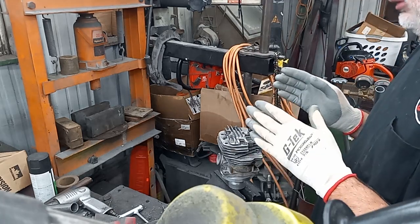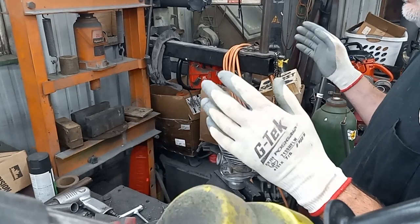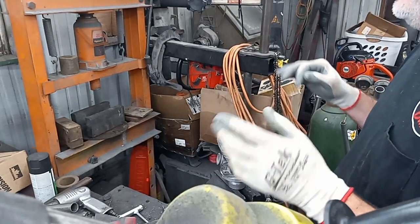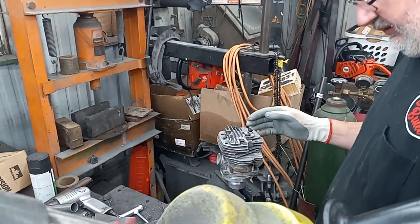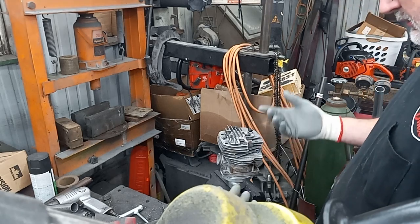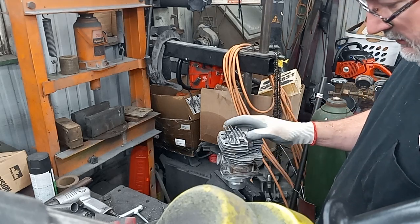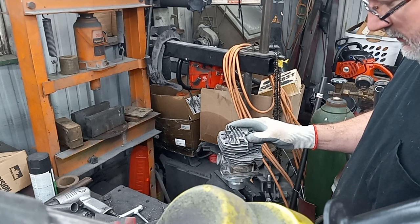Some people will actually slice in a little farther into the wall to get rid of that. I don't like to do that. I'll go right to the wall, and then I'll just radius the piston. It's not that hard to radius the piston. It helps promote flow off the transfers anyway, that first crack. So it doesn't hurt my feelings any.